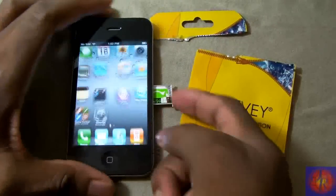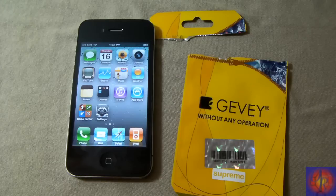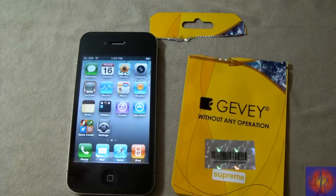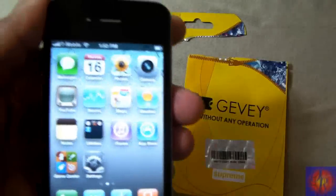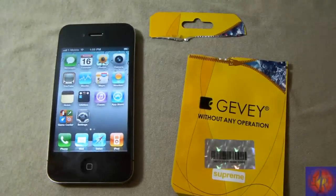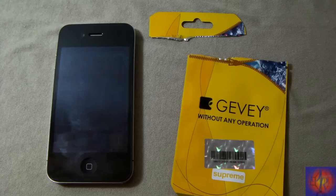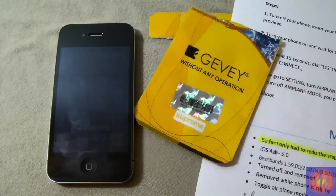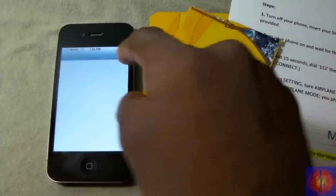I'm going to take the SIM out — 'No SIM card installed' — and push it back in. As you can see at the top: T-Mobile again, four bars. I did not edit anything. I also tested removing it while the phone was on and toggling airplane mode on and off — it still worked. Compatible from iOS 4.0 straight up to iOS 5.0 beta 1; basebands are 1.59.00 — I'll put everything in the description.